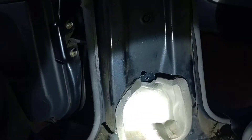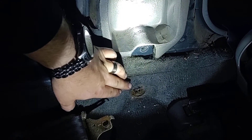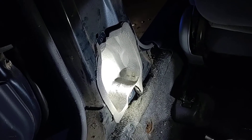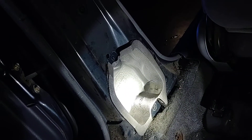Then we're gonna pull it, make sure it works, and make sure it catches — that the belt's good. Then we'll be putting the upper cover back on, the pillar cover over here, and just sliding that cover on the bottom there. And that should be it. Double check that the belt goes into its socket in the seat — you want to make sure the belt works before you go to try and use it. You'd be unfortunate if you went to try and use it and for some reason the belt didn't go into your socket in your seat. But that's pretty much it for replacing a seat belt on a 98 Accord.